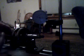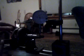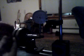Now this is, you know, one of the guys that do the racing stuff. This is actually, as I spin it, within 2 thousandths. I'll tell you, there's probably a lot more cranks out there that are running far more run out than that. That's of course still unacceptable to me. 2 thousandths is unacceptable. So I'm going to keep working with this. But like I said, I don't want to make an actual 1 hour video. I'm already at 20 minutes. Way too long. So I apologize for that.